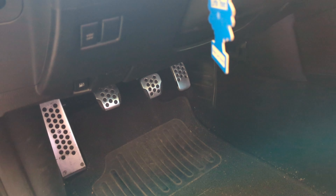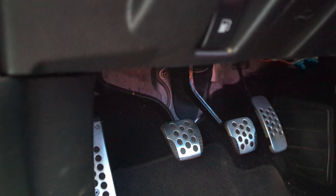Right there you can see a little nipple popping out on the clutch safety switch — it's come too far out. So we're going to be replacing that. Well, not actually replacing it — we're going to use a paper clip to just bypass the connector. Pretty easy and straightforward.